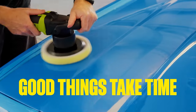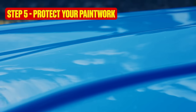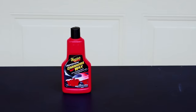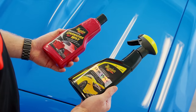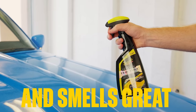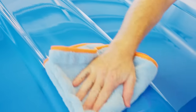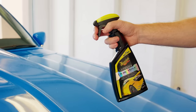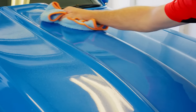Sorry, there's no sugar coating it — this is the longest part of the process. But as you can see, the work will pay off. And don't worry, step five is your last one and it's much easier: protecting your paintwork. A quick wax coating will not only protect your hard work from the elements, it'll add that extra glint to your vehicle. You can use a paste wax or a spray. Paste tends to protect for longer, but spray is easier to apply. With a paste wax, apply it with a clean hand buffing pad in a back and forth motion using minimal pressure to get even coverage. Allow the wax to dry, then wipe it away with a clean microfiber towel. With spray wax, simply spray it on, then wipe it over with one microfiber towel and remove it with a second cleaner towel.